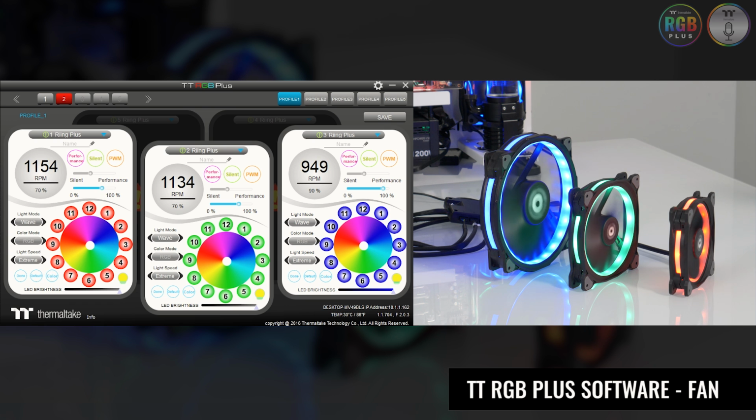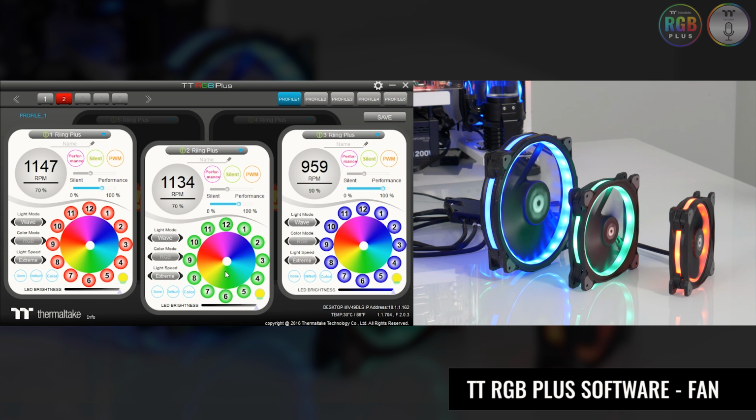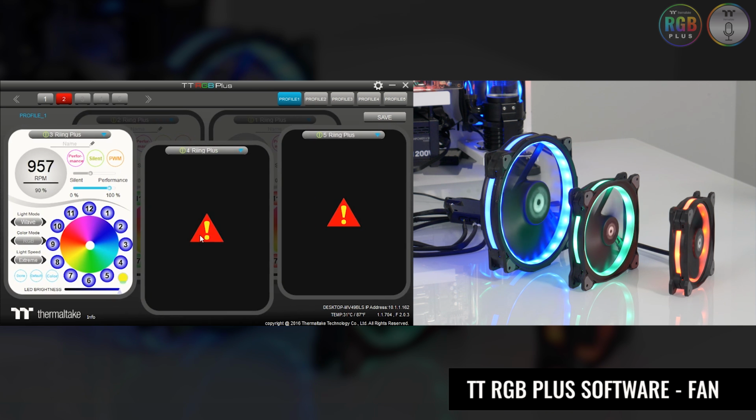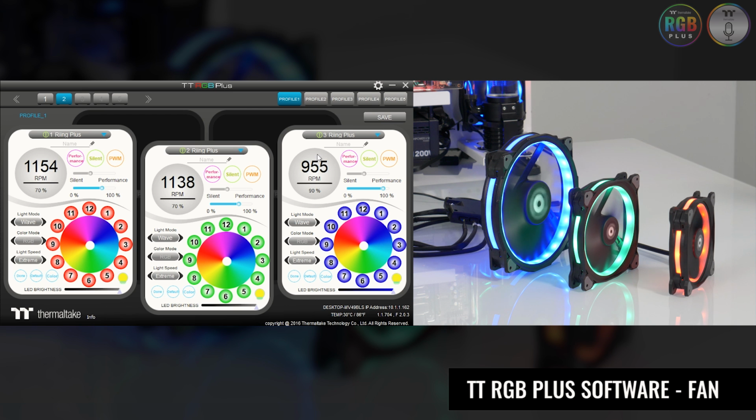But on the first look, when you have your system connected and I'm not populating ports 4 and 5, I'm going to get a warning message that's going to pop up. Now this warning message is basically telling me that ports 4 and 5 are not being detected. Clicking this green circle will then turn to a red dash and it will disable that port, telling the software that it no longer needs to worry about those ports. Now with each of my fans, I have all 3 fans set up here. And these fans are running at a variety of different settings and colors. I have fan 1 red, 2 is green, and 3 is blue.